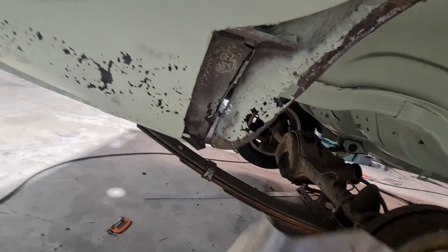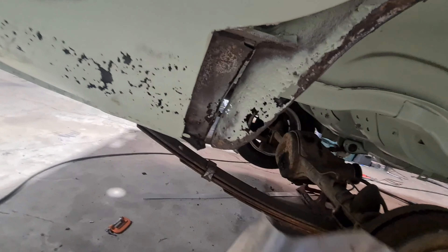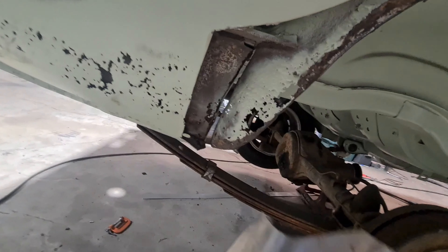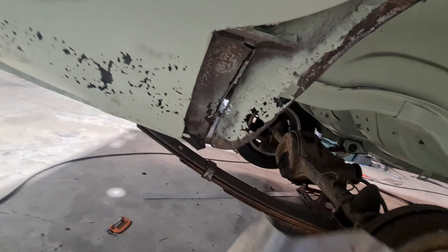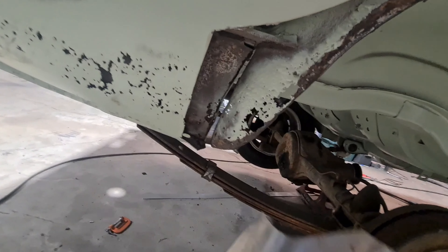I'll get started on the other piece now and marry the two together. Same with the inner piece — way too much material here, so I'll do a slit there and probably a slit here and see where it all gathers to. Just sitting the guard back on the car to make sure everything bolts up, then use bolts in the spot weld holes to make sure it's all in the correct location. This area is pretty paper thin now, so I'll probably end up remaking just this section — it's spread chaos a bit further over and torn the edge.